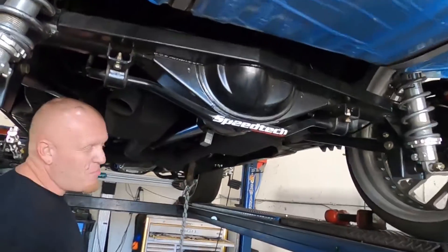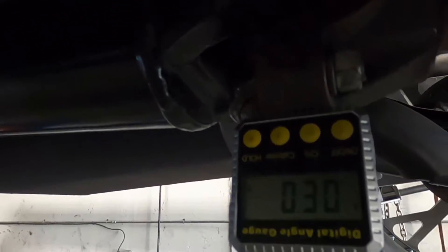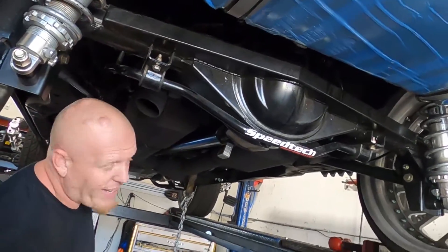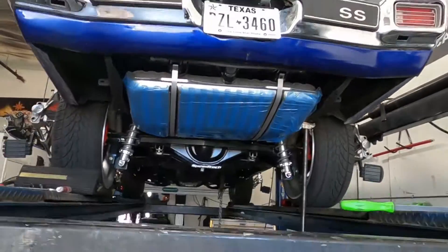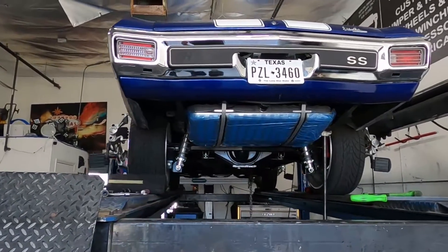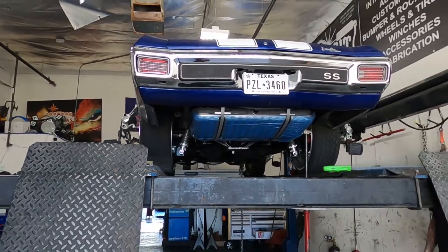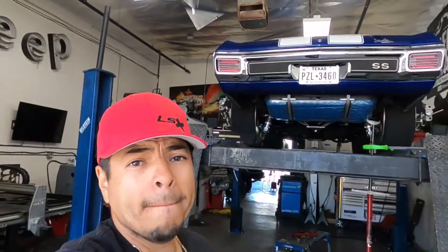After some YouTube magic — moving those coilovers and adjusting those A-arms was a pain — we went from 0.8 down to 0.3, right on the money. The driveline angle looks beautiful, it's straight. Hopefully no vibrations after that. You definitely want to make sure you check pinion angles when you're doing swaps, lift kits, coilovers, or any suspension work that changes the geometry of the car.